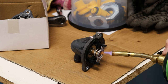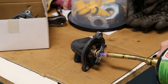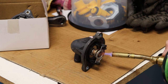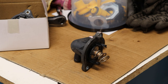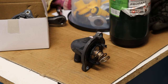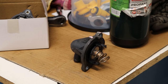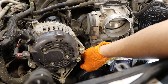If you've never seen a thermostat work, this is actually pretty cool. It heats up — there's a little wax piece on the inside here, and once it melts that, it lets it spring open. It's getting hot. It's starting to move. It's hard to tell if it moved on its own or if it just melted the plastic. But anyways, that's how they work — it heats up and opens up. It is open now. It's broken now for sure.